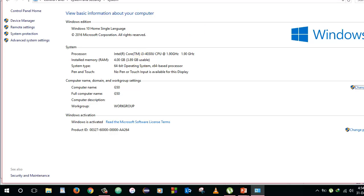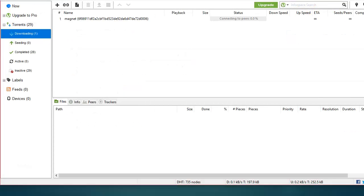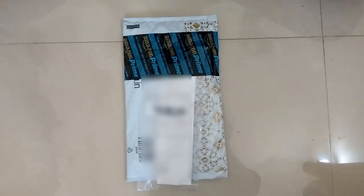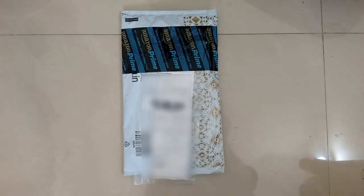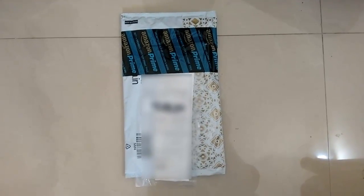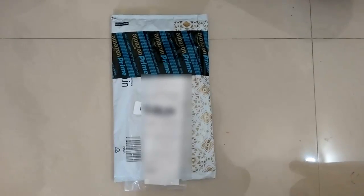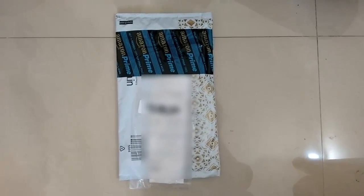So let's shut down the system. After doing some research, I found out the Lenovo G5070 laptop supports DDR3L RAM — that is double data rate, and L stands for low voltage.